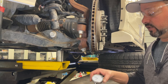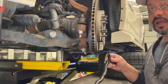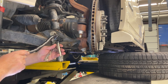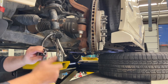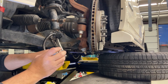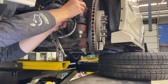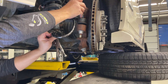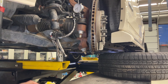To measure the ball joint play, we're going to use a dial gauge which measures in thousandths of an inch, as well as the mounting equipment that will mount the dial gauge to the ball joint for testing. To mount the dial gauge, we have to locate somewhere in the suspension system to connect the mounting tools and clamp them into place. This gooseneck will hold the gauge on somewhere on the spindle which will allow us to take a measurement of the ball joint. It takes a little bit of practice to connect this, but once you get it, it becomes fairly simple. We're going to lock the gauge in place — I'll have to put the wheel back on to do this measurement, so keep in mind that the gauge cannot come in contact with the wheel.